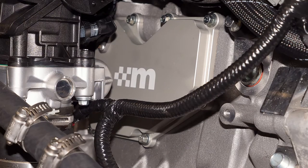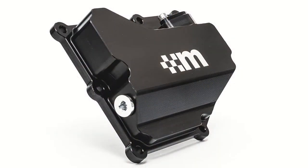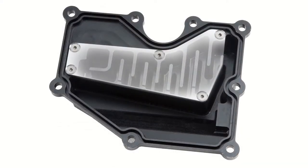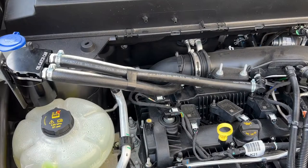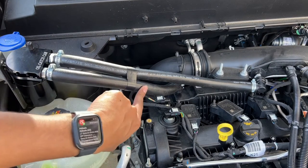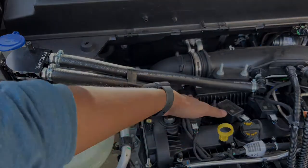However, in all of these racing applications, they are replacing the OEM oil separator on the side of the block with an aftermarket unit that has a substantially larger baffle, not to mention larger turbos capable of more vacuum. On the other side of the aisle, there are those that are going the cheesy way by just adding an oil catch can to the valve cover, or what is commonly known as the clean side.